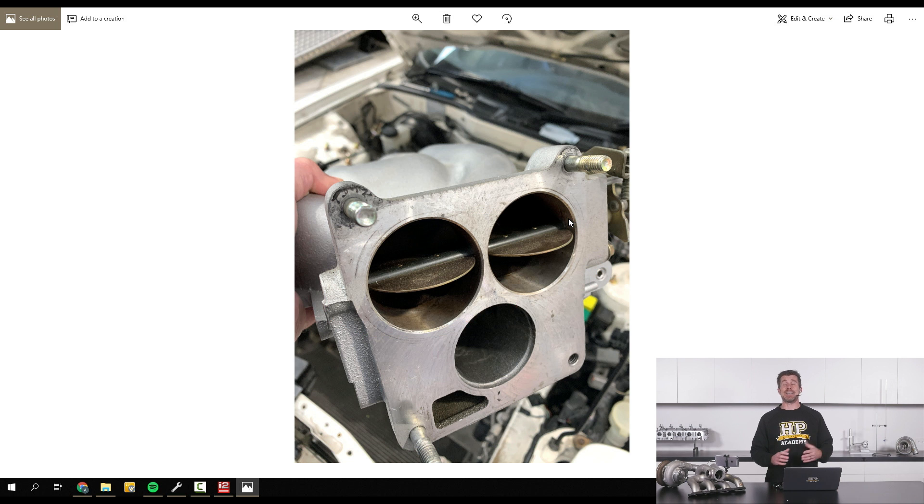The problem is we can't easily adapt a single throttle body to this system. There are a few ways of doing it — I know people who have run an LS drive-by-wire throttle body straight onto the upper inlet manifold. But what we're actually toying with is the idea of adapting a remote drive-by-wire throttle actuator to run the factory throttle body. That might sound complex, but many OE manufacturers do this — BMW with their S54 engine in the E46 M3, and also the E60 M5 V10, using individual throttle bodies with a remote actuator and bell-crank style ITBs.